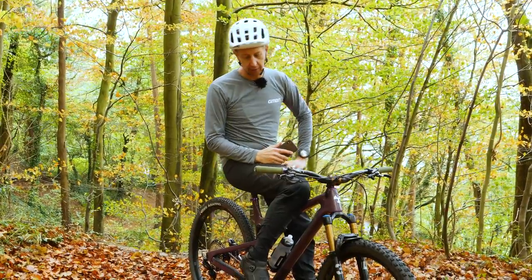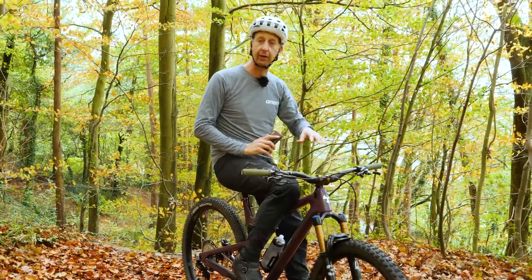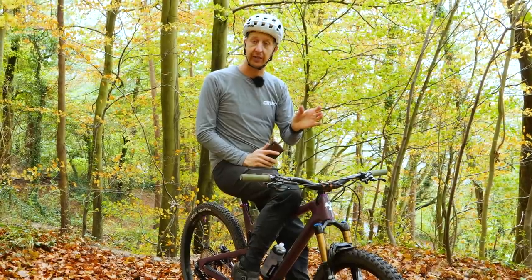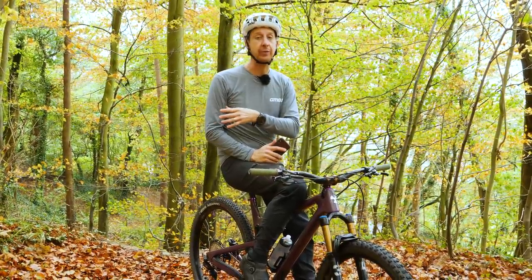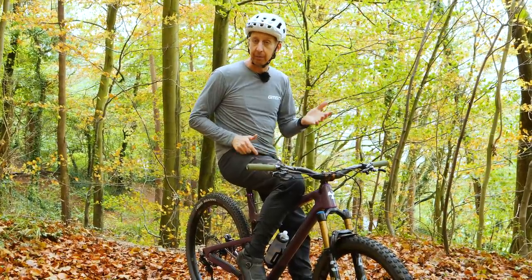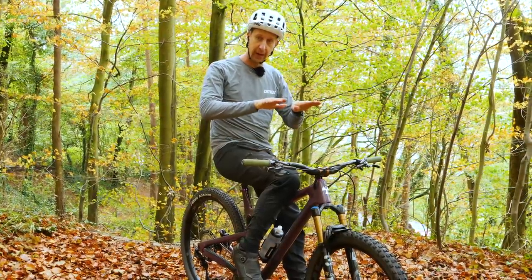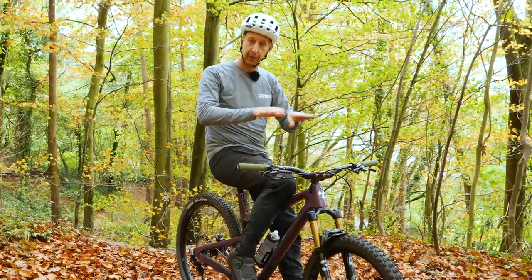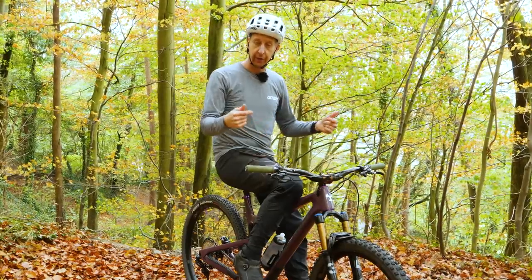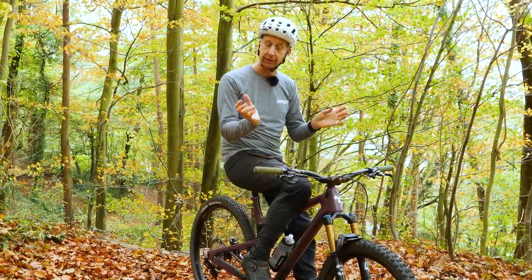What else? Cantilever brakes. Disc brakes are brilliant — there's no reason for any mountain bike not to have disc brakes these days, even budget ones. But once upon a time we used to have rim brakes. The best type were cantilever brakes — we did have V-brakes later which had more power — but the traditional cantilever brakes, it was the simplicity of them I really liked, because you had to set them up so well to get them to work well. You had to get the pads to hit the rim exactly right, get them to toe in, there was the up and down of the pads, the in and out of the pads. The further in you had them, the further out the cantilever arms were, so you had more power, but that could feel really mushy.